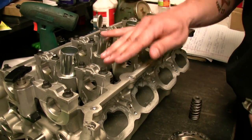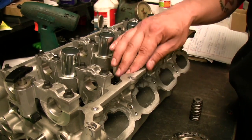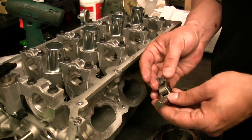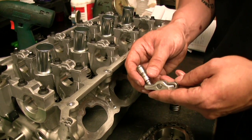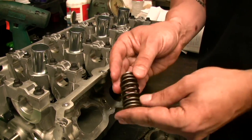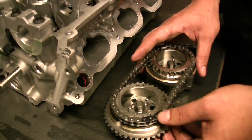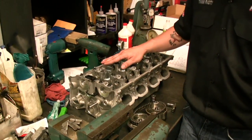Looking at the head — obviously it's a 32-valve cylinder head, similar to the Terminators and whatnot. Intake port testing: our numbers showed to be very comparable with Ford's, so it's impressive. One of the things we liked is the roller follower — it has a captured lifter in the follower, which makes for a better revving motor, more stable at higher RPM. Valve springs are nothing special, standard modular Ford fare. You've got your variable cam timing cam gears here — interesting design, but nothing extra special about them. Overall, nice cylinder head. Nasty piece.